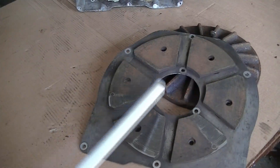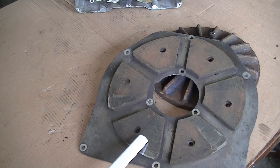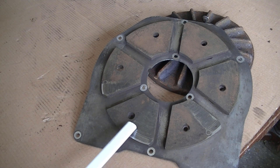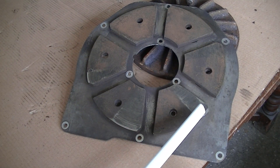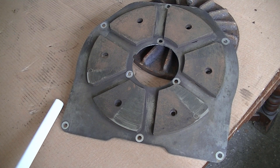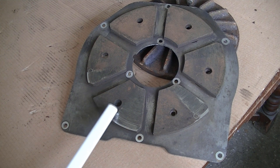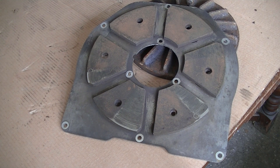There's been some distortion — this plate is bowed out. There was quite a lot of scraping, and once I've got the shim kit in place I will get rid of all the horrible noises. I've filed off the edges here — the rotor doesn't fully cover all of it and where it was rubbing it had dug in a groove of maybe a quarter of a millimeter, so I've filed those down. It was rubbing more at the bottom than the top. On the other side there was very very slight rubbing — almost in contact — so it definitely needs shimming out on both sides. This exercise of taking it off to do this is worthwhile even if I can't get hold of a coil.